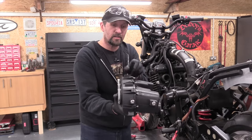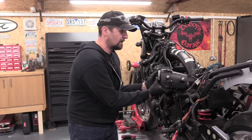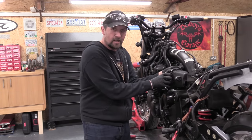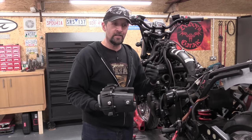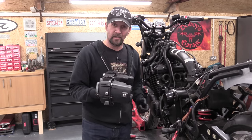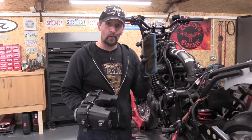To get that panel filter out, you need to separate the box, but it's absolutely wedged in position. It horseshoes around the frame like that, nice and snug. There's literally half an inch behind it, and to get it apart, you need to take the carburettors out, which means that for anybody taking these for service at the dealer, there's probably quite a hefty bill in labor, in getting everything stripped out just to get to an air filter. And that leads to them getting left, and that leads to them being 20 years old and falling apart.